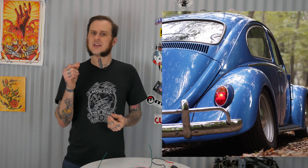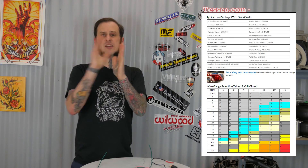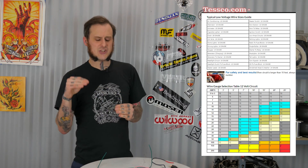Something like a taillight or a turn signal is not a heavy wattage circuit — it's not pulling a lot of power and it's not under as constant a load as a headlight or a fuel pump. For that I'll go with 16 gauge or 14 gauge depending on the distance. I'll throw a link in the description to a chart that breaks down recommended wire sizes for different circuits in a car. Personally, I usually step up one wire size versus what's on that chart — those are kind of minimums. For example, the chart says 14 gauge for headlights, but I already said I use 12 gauge because I want to provide better power and bright headlights.